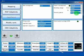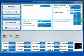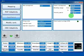This is needed for cars, for example, that need more power at higher RPM, very powerful cars, and there are some conditions where we can't give enough LPG or enough CNG to make the car work in the right way, so we switch to petrol for security reasons or even for having more power. And for the same reason, I will make you see, as we did before, we can set, for example, 4 milliseconds. Now we will try on idle. Okay, I will do some tests. As you see here, the light turns on. We can get on petrol, because we have a petrol injection time that is above 4 milliseconds.